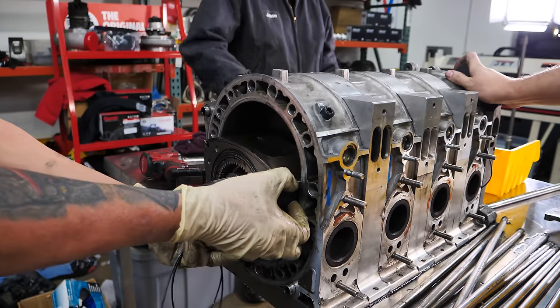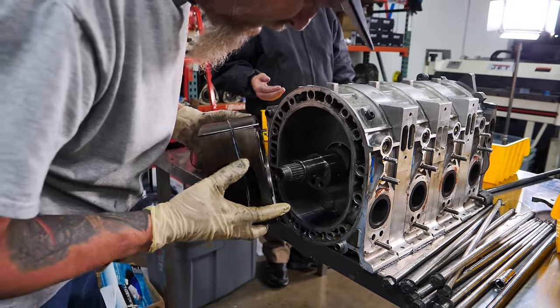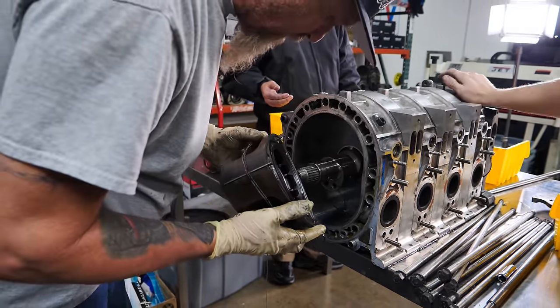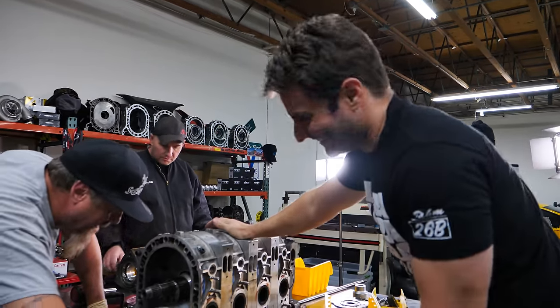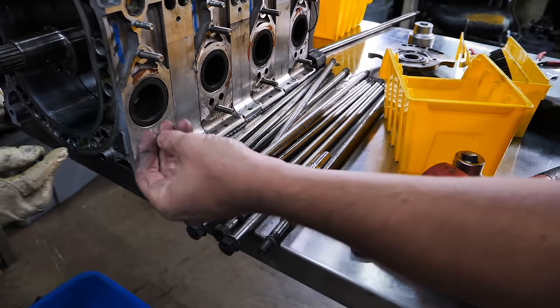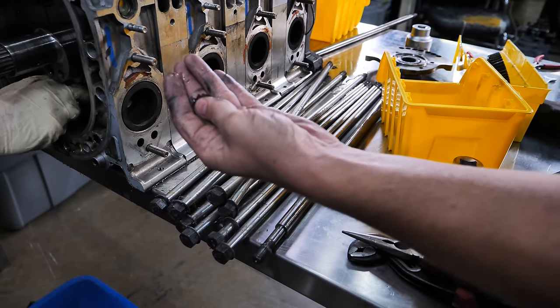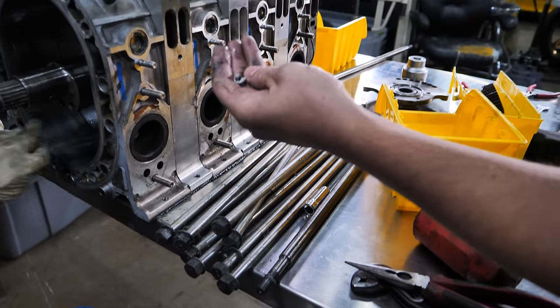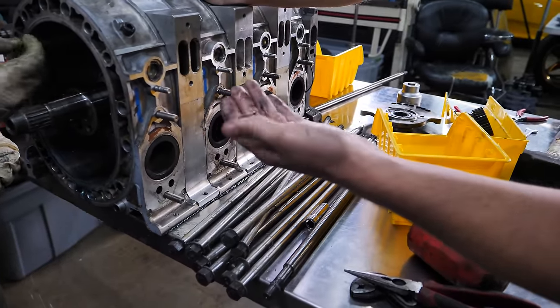Here she comes — that looks clean as hell. We'll go more in depth on each of the rotors once we have it all disassembled. Oh — there's where rotor four was having that one bit of lower compression in two of the faces. That's two-stepping the f*** out of it. Corner seals commonly break when you two-step or you have bad timing — and I've had both.